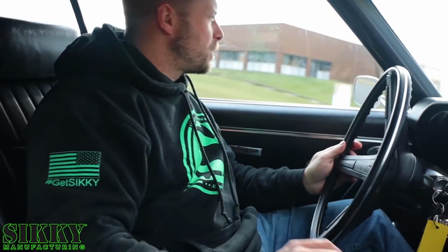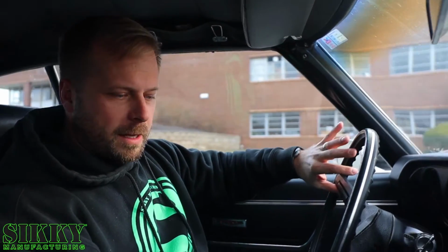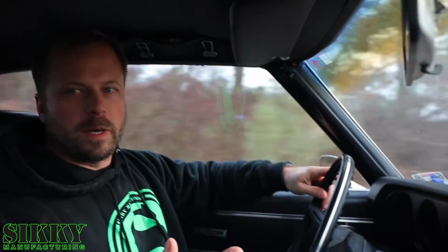Felt like we had turbo boost kick in there when the fuel mixture cleaned up, but yeah, if we were keeping the stock motor on this thing, it would need a substantial tuning job to get it running right. It has a lot of weight transfer, which isn't a bad thing, but the fact that it's got an open rear is not helping us at all, because even this old tired motor can easily light up the one rear wheel. If we didn't fix the traction issue, the new motor we put in here would be all for a waste, because there's no way you're getting that power down to the ground. So definitely a modification that's going to be needed is getting that rear swapped out for a modern posi unit with disc brakes.